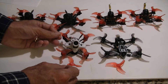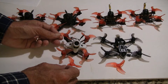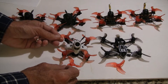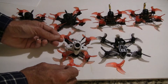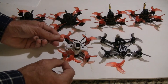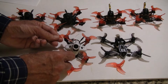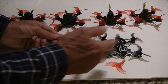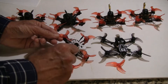When the Tiny Hawk Race 2 came out, a lot of people criticized it for not having two and a half inch props. When the Baby Hawk came out, I found the two inch props were terrible, and I put two and a half inch props on it — it was a completely different machine, a lot better, longer flight times, faster, a big improvement. But this time I think Emax did their homework on this prop, and with the sizing it's a little bit smaller, a little bit lighter, a little less air resistance, and I think the speeds are pretty much the same as the bigger brother. The handling is as good, if not better, and I think this two inch prop works out pretty good.